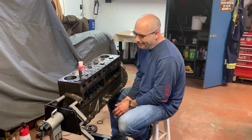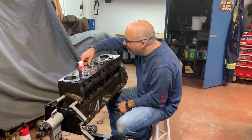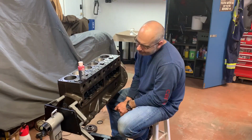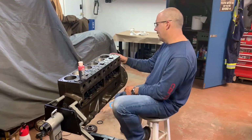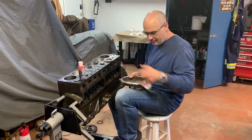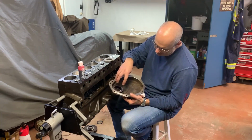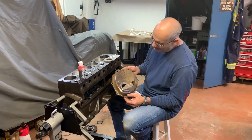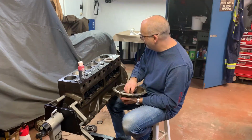Anyways, well, thanks for following along. I think we're going to call that a wrap, maybe, for now. It's been a while since I had a video out, so I'll upload this one, and this week after work I'll start checking bearing clearances, get back on that front end, get it polished up. I got to go see my friend with the press again. The seal in the front cover. I don't think I want to drive that in there at home myself. I think I'm going to have my buddy push that in with his press. We'll put a piece of pipe on it and push that in. And we can get the front cover on. I haven't painted it yet because I'm going to wait until everything's assembled, close everything up, and then I'm going to paint it after that with high temperature heat paint.